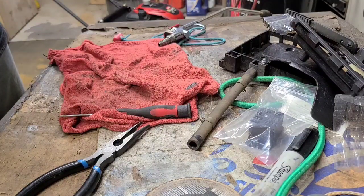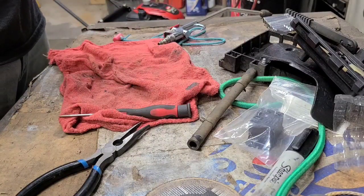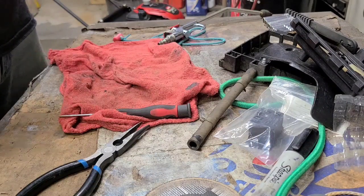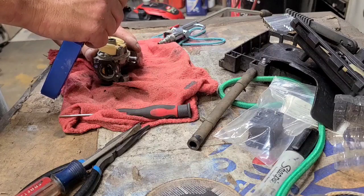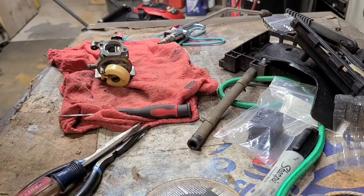All right, I'm going to see if I can open up this and push that emulsion tube. I'm not going to push it hard. I'll see if I can push the emulsion tube out with a screwdriver. I like to pop that out so I can make sure the holes in the side of that are clean, but sometimes they don't come out. Nope. I'm going to take my torch tip cleaner here and find a wire that'll go through the middle of this and just run a wire through it. Wire goes all the way through. Doesn't mean that the little holes in the side are clean, but